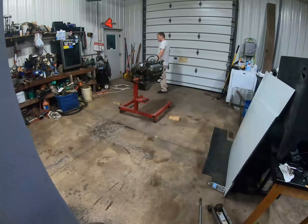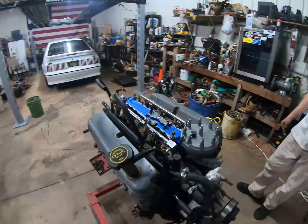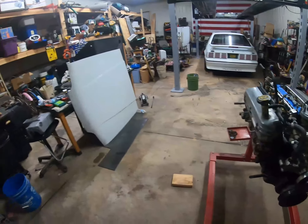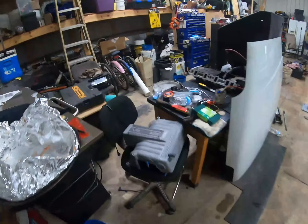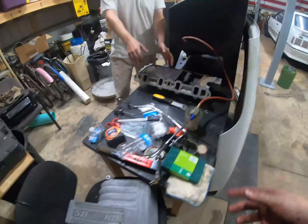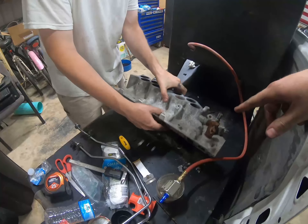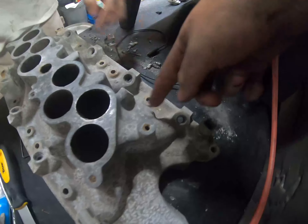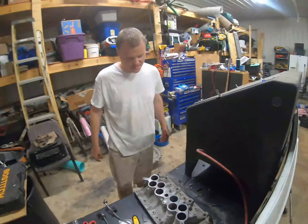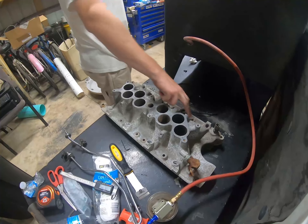It went pretty good. Probably the next video we'll be tearing this down further to start putting the heads on, the cam, and all that. But we also have to do some work to this intake — this is a GT40 off of an Explorer because we can't get our Holley intake yet. We have to drill and tap a hole for the ACT sensor. There's a boss right here where it should be, but you'll only have that if it's an old-style GT40 lower. The newer ones from '97 on don't have the boss.